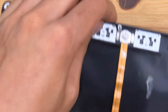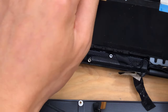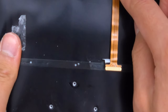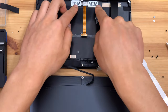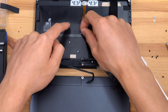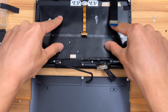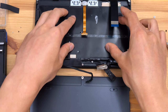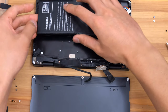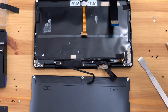I'm not sure what the button does. Let's open the laptop and see if it clicks — I believe there is nothing over that to catch that click, which is interesting. That looks like actually it's an off-the-shelf part. The keyboard does appear to be metal-backed and can be removed. One thing to note is the keyboard backlight is connected here. The backlight is mostly a contiguous sheet of plastic, but if tea or water is spilled on the keyboard, especially near the mouse keys, it will enter the device. Unfortunately there's nothing except for the battery in the bottom, so there's some hope for the device not being damaged.